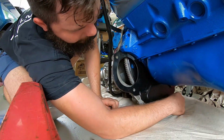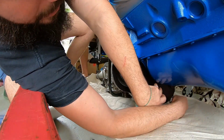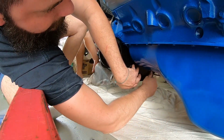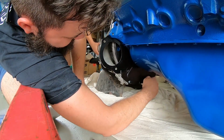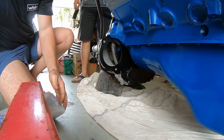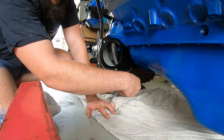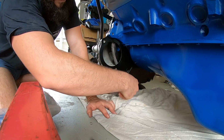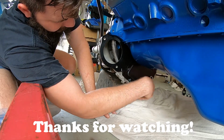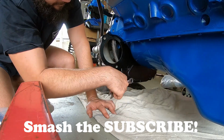Oh, use my mind's eye for this one. Hopefully you guys on the camera can watch and actually see. I'm going to wedge this old transmission hump under the pan, guys, to level the engine out so we have heaps of clearance when we come to fitting our extractors in a minute. Awesome. Now we don't have to worry about keeping the engine level per se at this stage, guys, because the box is on, there's no converter that could potentially slip out and fall forward, but I'm just going to level it out anyway. Beautiful. Just a knee turn, guys, half an inch. Yep, that's it. That's it.